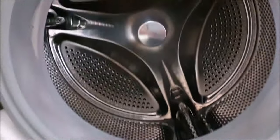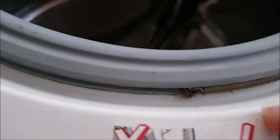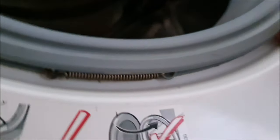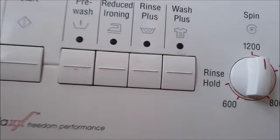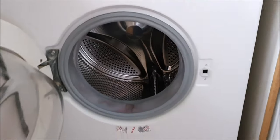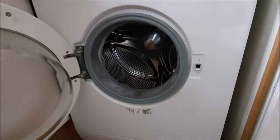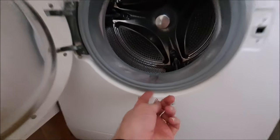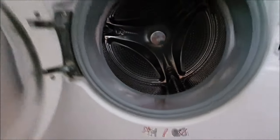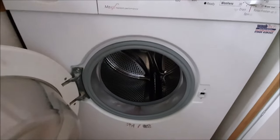In order to get to the mechanism at the rear of this switch, I have to remove the rubber door seal. If you look underneath here, I'm hoping you can see there's a spring and that's around a piece of metal that surrounds it - you can see that keeps it in place - so I've just got to remove that. Just to clarify, my spring is at the bottom, but it doesn't necessarily mean the spring would be on the bottom on your washing machine; it'll be wherever whoever fitted it has put it.